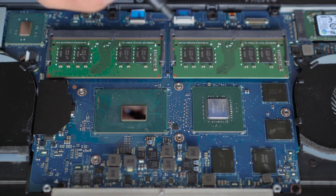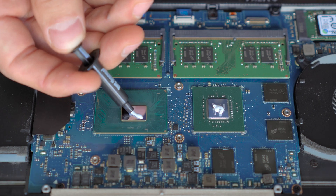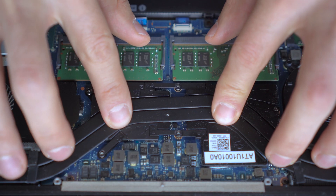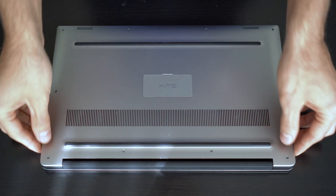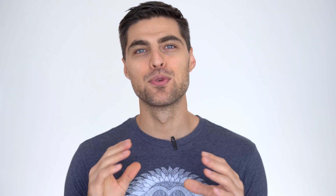You don't need to put an excessive amount of paste — for me that was about one to two drops. Once the new paste is applied, push the heat pipe assembly back in place and tighten the five screws. Don't forget to reconnect the battery connector and close the back cover by tightening all the screws you removed.